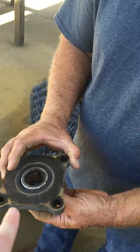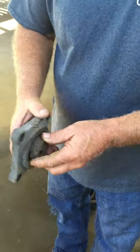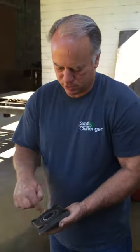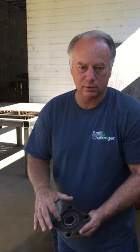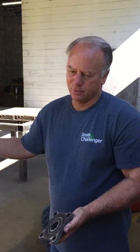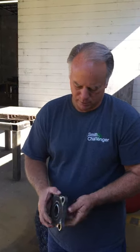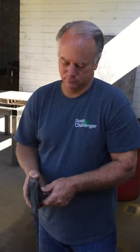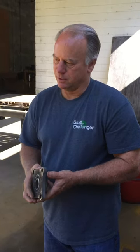What could cause that kind of wear? It could be a lack of grease, or string could have wound up in there and physically eaten out the seal — which is probably what happened here. It's very important to clean string out of the idle bearing and the drive motor at a minimum of every brush change, because the bearing is relatively cheap to replace, while the brush motor is not.